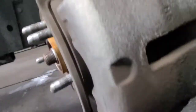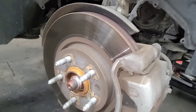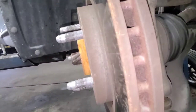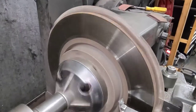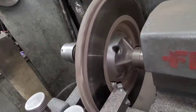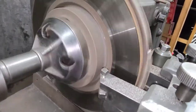I'm going to turn it on the brake lathe, so I gotta remove the caliper. To do that, just remove these two 18mm bolts — that one and that one. Then just hang the caliper. Now remove this Torx, which is a T-30. I have it on the brake lathe now — that's what it looks like. I'll show you guys once it's finished turning.